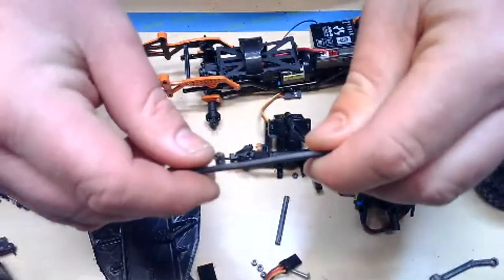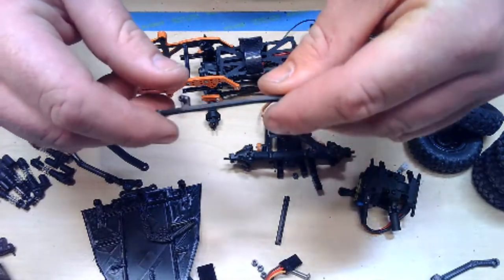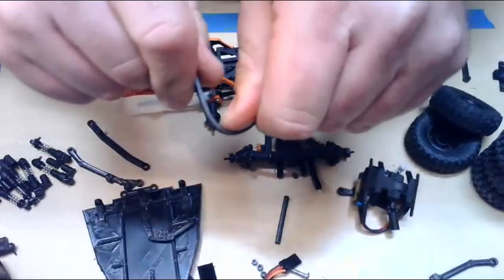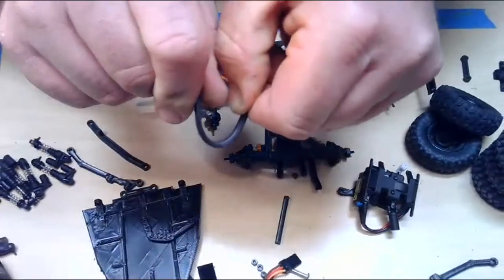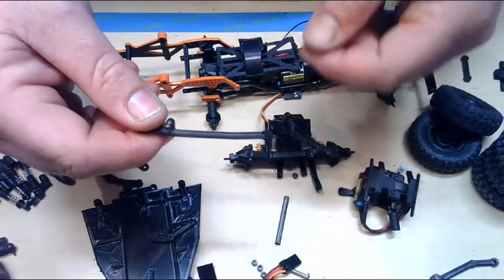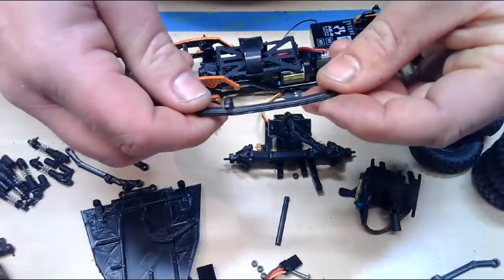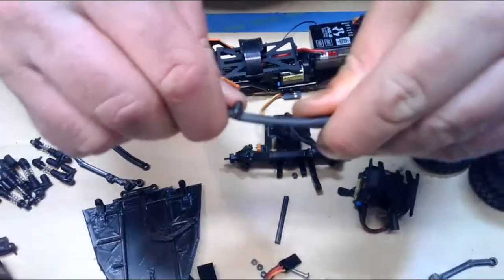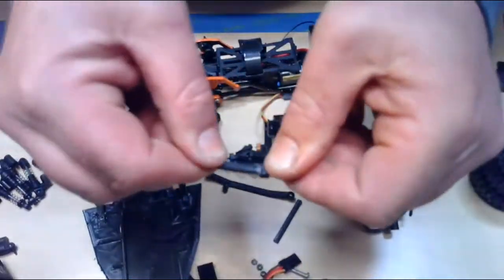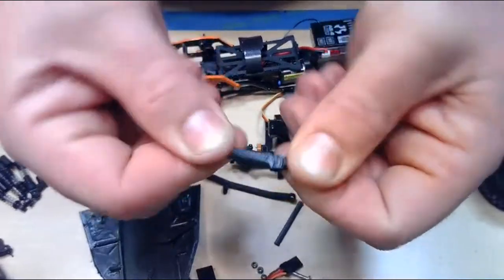When you start to mount all these little rods, after you get the original ones off, here's a real quick demonstration. The stock ones that come on the Axial are some kind of nylon. It's very flexible, very durable. In the plastic world, it's tough but not very strong, as far as snapping. It'll never snap. You'd be really hard pressed to make this thing snap, but they do give. So when you turn, if you get in a bind, they'll bend and give. The plastics I use are ABS plastic, and they're probably 5 or 6 times harder than whatever this nylon mix they use is. So they don't bend